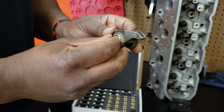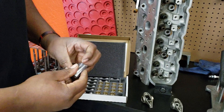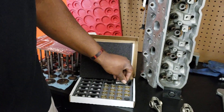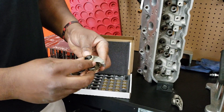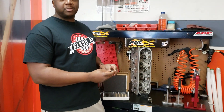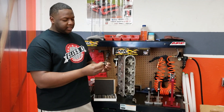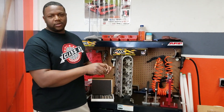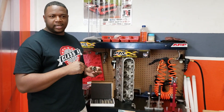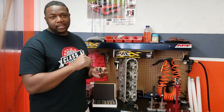They come with keepers — you have all the keepers right here. You take them out and put the keepers on, and then you're done. You do that for all 16 of them. This gives you nice even wear, and that's the reason why we like these over the other press-fit ones that are a little cheaper. But spend the money and get these — it'll be well worth it. Until next time, this is James at Class A Performance, Muscle Monday.